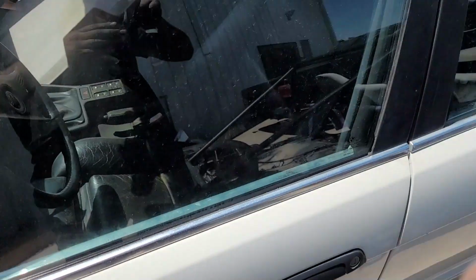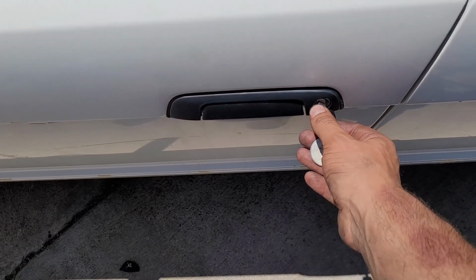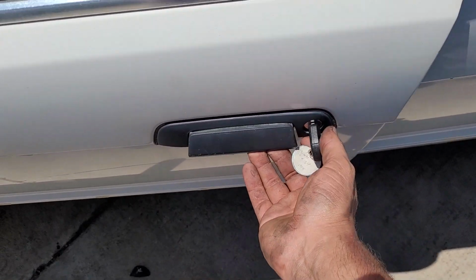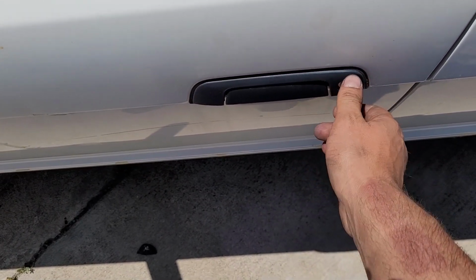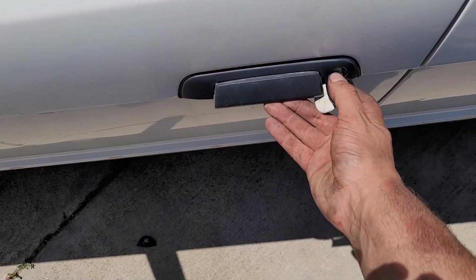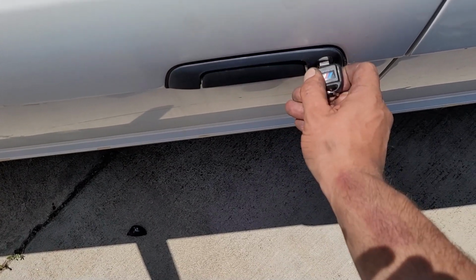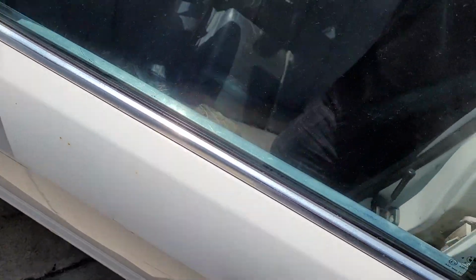So yeah, I remembered after I couldn't get in there, there's a thing called service mode, or not service mode, I don't know, emergency access mode, whatever it is. When your batteries die in your E34 and your E32, normally your lock only turns to there, but if you lift the door handle, oh, it's locked now, it's unlocked. So see, I can only turn to there, but if I go like this, then I can get another turn into it, and that turn right there opens the door.